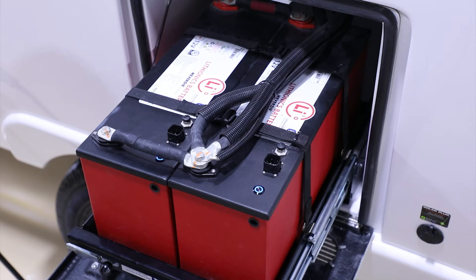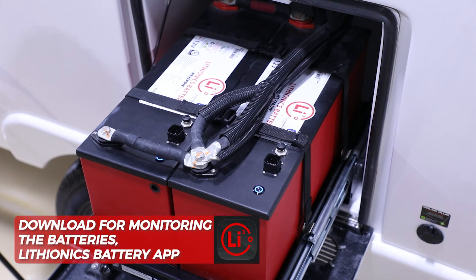During bulk charge, when the charger is set to 150 amps per hour, you can reach full charge in as quickly as four hours. Because these batteries don't operate the same as a standard 12-volt or AGM battery, instead of looking at the voltage display inside the camper, you'll want to download and monitor them using the Lithionics battery app. That app will show you the true state of charge based on percentages, so you can see where the battery level is. Once it gets below 50%, you'll definitely want to start watching what you're using.